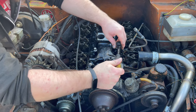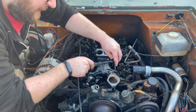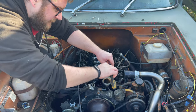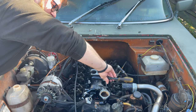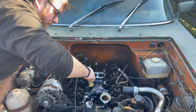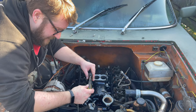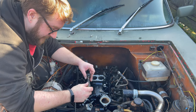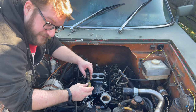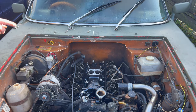I'm just gonna nip these up. These bolts have to be torqued to the correct setting, so it's very important that you don't just wang them in and hope for the best. And as I said earlier, don't use an impact wrench — don't use one, because you need to feel it.